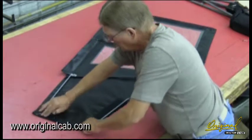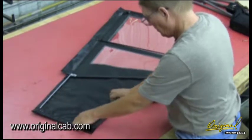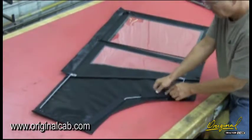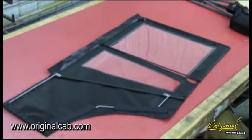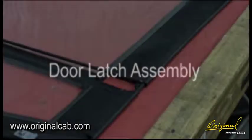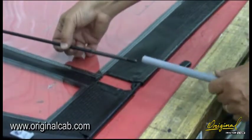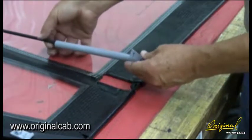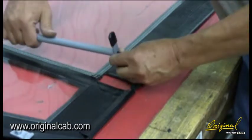Close the snap flaps and/or the velcro strips around the ROPS. Step 9: Install door latches. This will require the 3/32nds allen wrench. See figure 1. Loosen the set screws in the collar welded to the door and pull the rod out. Slide a spring-to-open rod to the stop. Slide a door latch onto the rod, reinsert the rod into the collar, tap lightly to seat the rod, and then tighten the set screws.